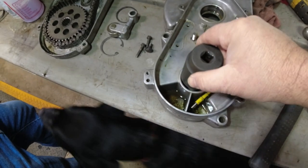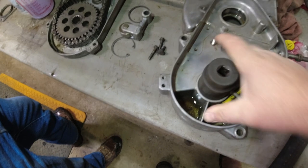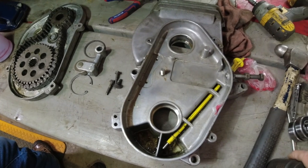We need to get Dennis' TX340 ready for Brat Fest. Let's put the bearings. I've got this Tekton inch-and-a-half, half-inch drive socket — it just fits down in there. That's what we're going to use to run the bearings down, and we'll probably use the same thing for the seals.